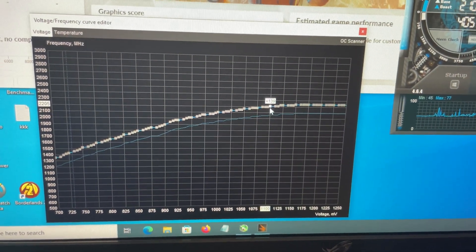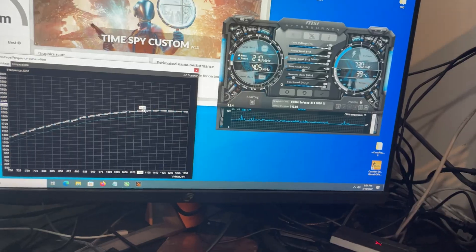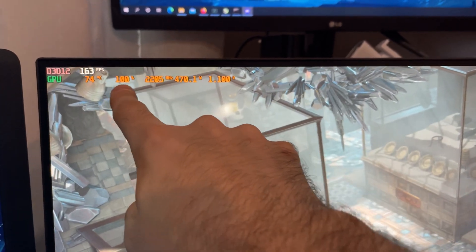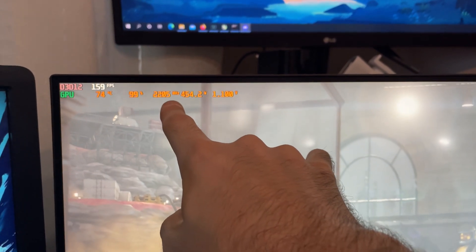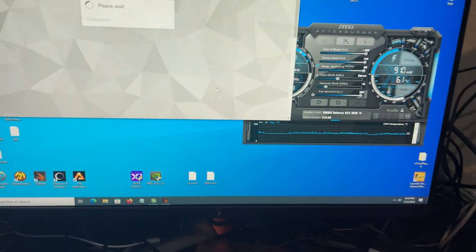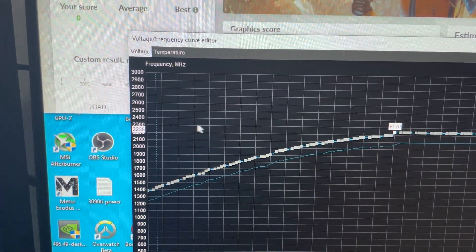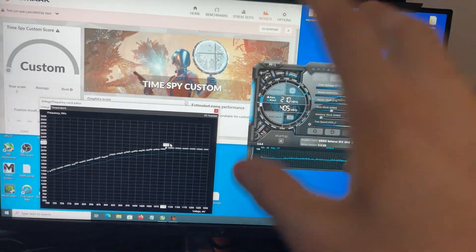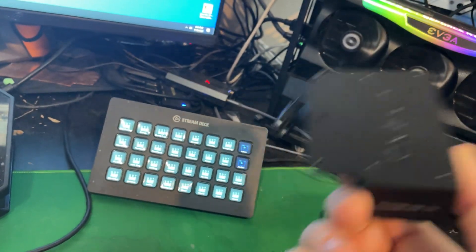For this next test I'm going to move up the 1.1V slider and see what the maximum frequency is that it'll pass five loops. Then we'll install this thing and see if we can actually get any more frequency at our maximum. It's getting quite hot, but we managed to lock it at 2205 — it might even downclock to 2190 if it gets a bit hotter. In Afterburner it's set to 2235. So 2235 in Afterburner, 2205 in Time Spy after five loops — and that is without the power booster. Now let's go install this thing.